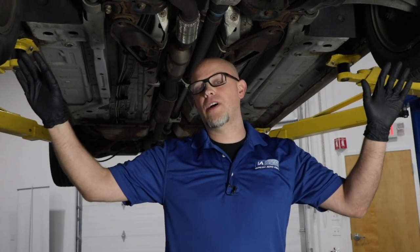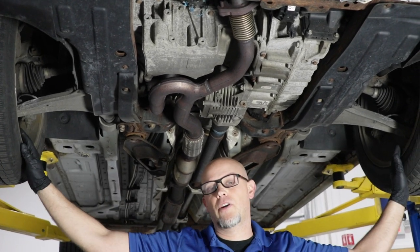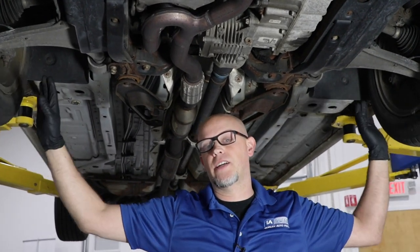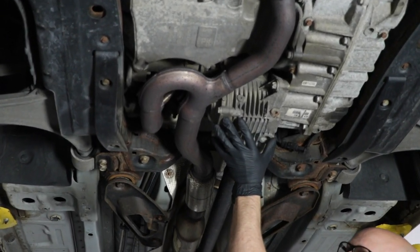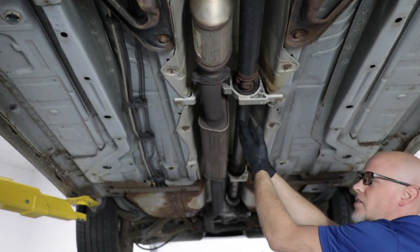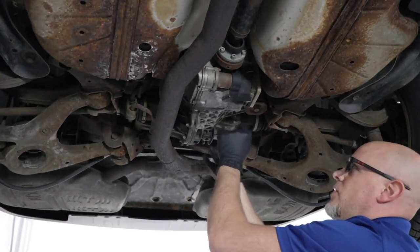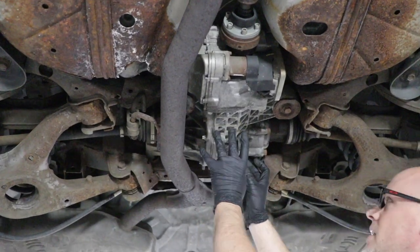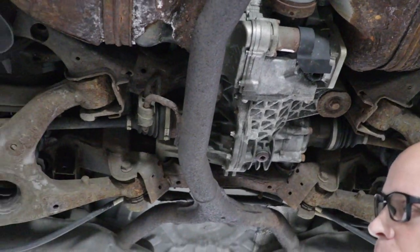If you only have a two-wheel drive Buick LaCrosse, you only have the two drive shafts or axle shafts powering the front wheels. When the all-wheel drive system is disabled, those are the only tires powering the vehicle. In this vehicle, we have the transfer case right here, and it goes to the drive shaft that goes to the rear of the vehicle. Then you have the input to the rear differential assembly, there are clutches in here, then the rear differential, and then the axles that power the rear wheels.